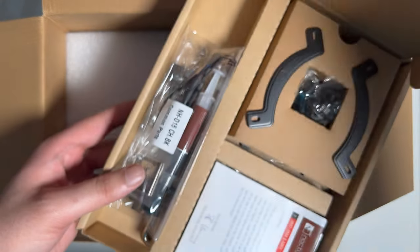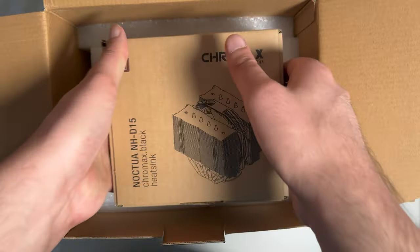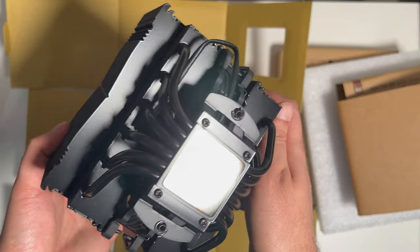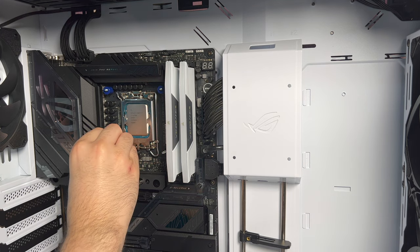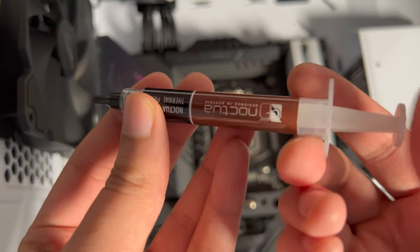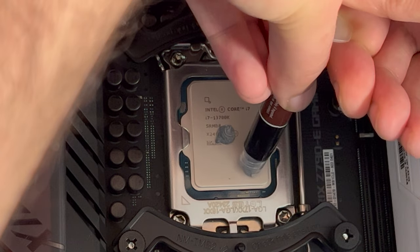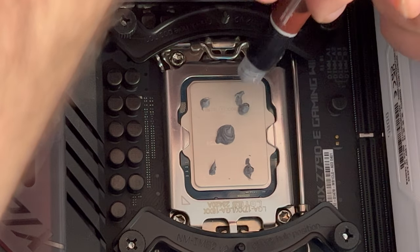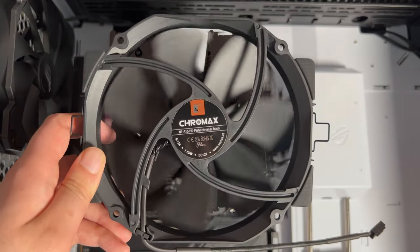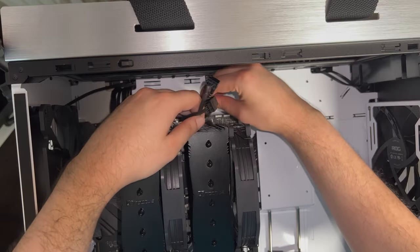So the NHD15 — there's a mounting bracket, thermal paste, and the fan cables. It comes with a second NF-A15 fan. Just look at the shine on this thing. It's quite beefy, which is a shame because it will block some of the RGB coming from the RAM. You will have to align the mounting bracket a certain way according to your CPU socket. This is the NTH1 thermal paste — I would have preferred Noctua bundled the latest NTH2, but this is good enough. This is my first time using thermal paste; I just followed the instructions provided, which is a dot on four corners and a decently sized dot in the center. Installing the heatsink and now the fan, making sure it's on the side where it blows air towards the rear fan. And now the second fan — I had to keep this higher due to RAM clearance. And I think we're mostly done installing components.